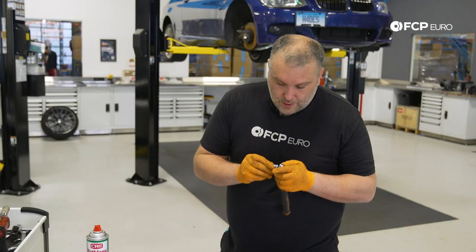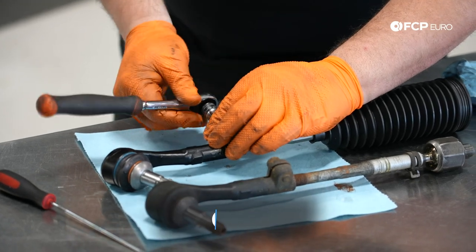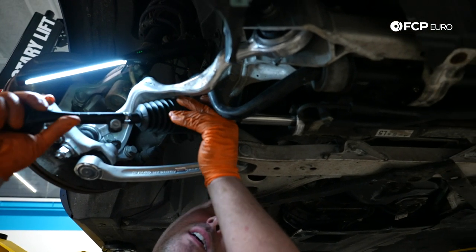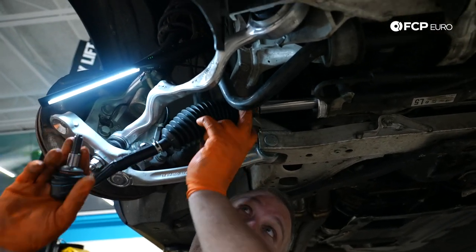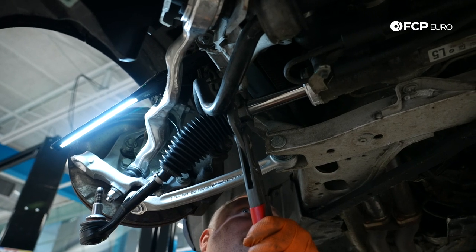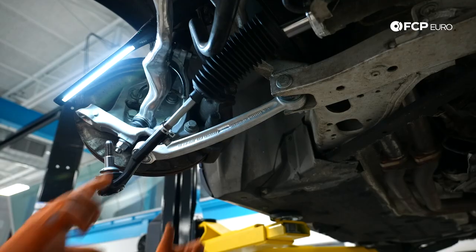I'm going to make sure this adjustment doesn't move. This screw right here is a T50 — I'm just going to go ahead and cinch it down, not absolutely tighten it to torque yet, just tight enough that it won't move on us. Now we need to get the inner tie rod end thread started on our steering rack. A 38-millimeter crow's foot is what would be required to torque this properly, but I'm using big channel locks. All you're looking to do is snug it up and you'll feel it bottom out.